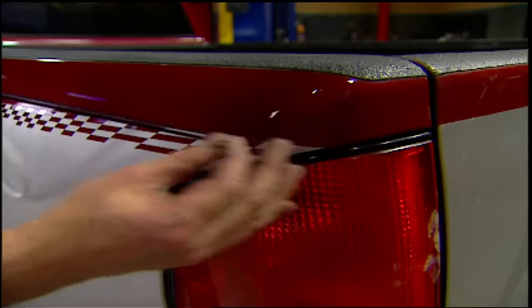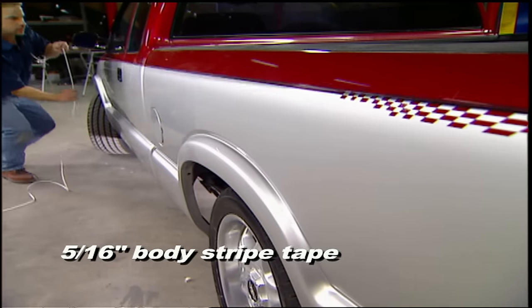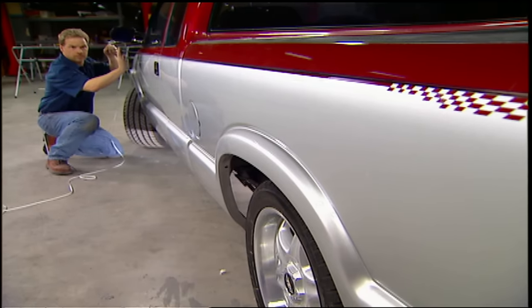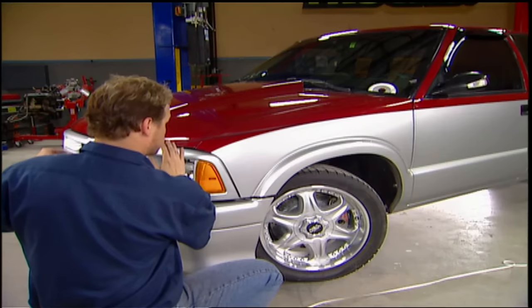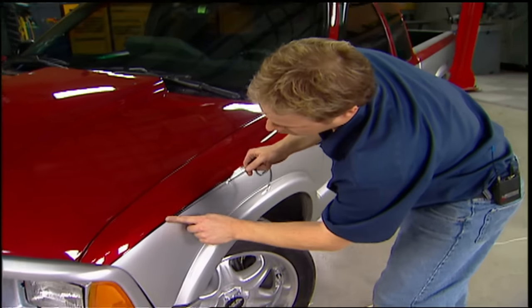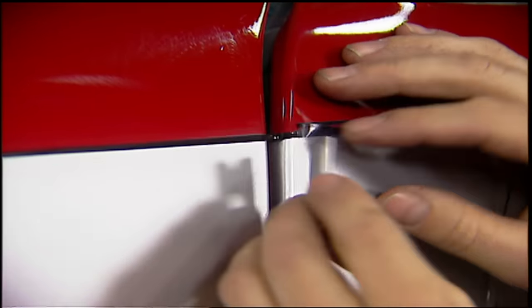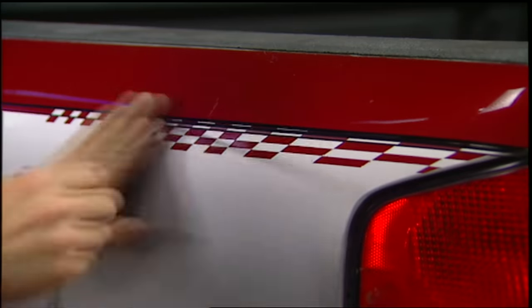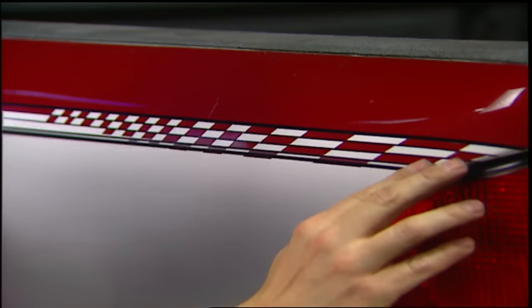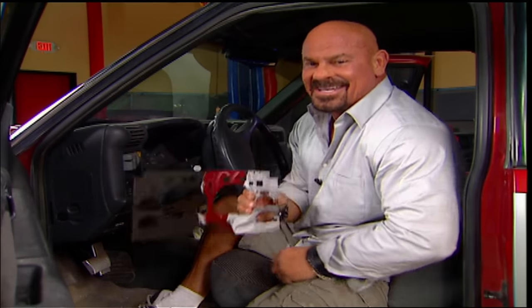You've got to use it right though. Pull enough striping so that you don't have to hold the roll while you're working. Stick the end of your stripe to the edge of the panel and pull off enough paper backing to stripe the whole panel. Gently stretching the tape will give it tension and ensure that your line is straight. We used five stripes of quarter-inch fine-line tape, removing every other square before we sprayed it, then used the black tape as an accent. With the exterior done, we're going to spend a few bucks on the inside — with these stainless steel inserts, it's really going to set things off in here.